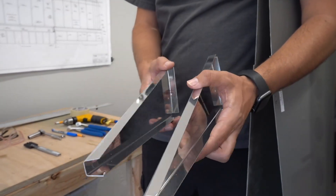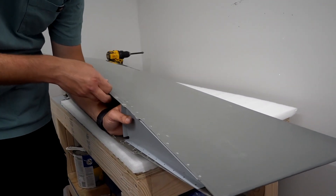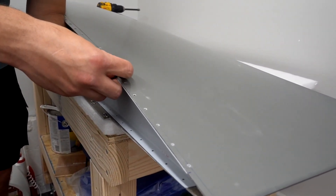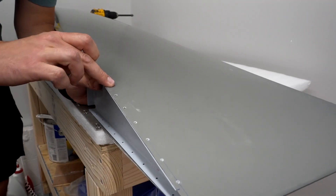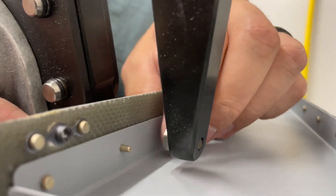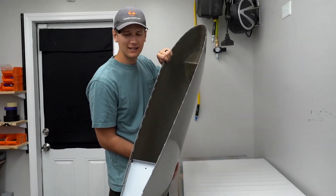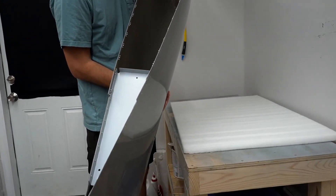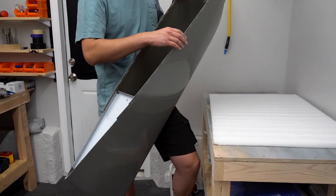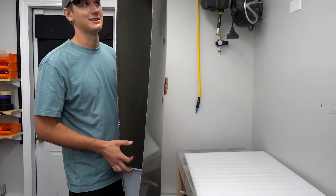Final little piece of the wingtip rib — done. It's primed. We'll slide it in, cleco it, but we found it was a little better on the other one to pop some rivets in first. The wingtips are basically at a point where we're going to stop for now. We just got the wingtip ribs in. This is where the aileron goes, so there's nothing back there. This is where it connects to the wing. Some people flip these around — we just did it to the plans.